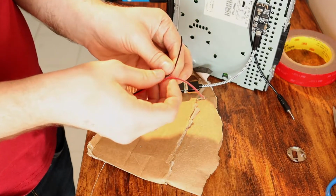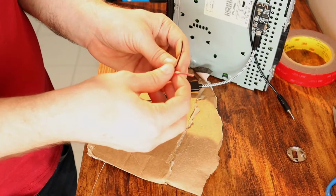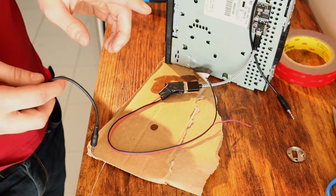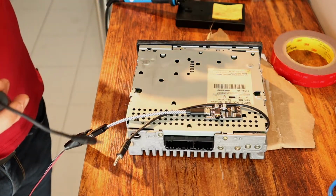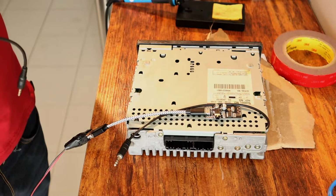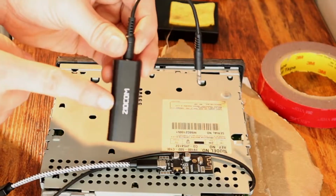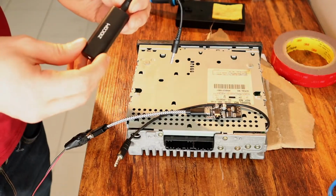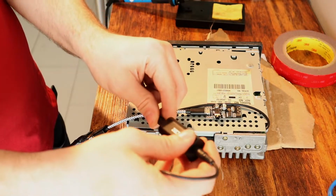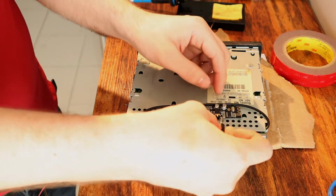And basically I'm gonna cut into the wires that go to the power outlet. But because of the way that we're getting power and the way that we're grounding this, this is gonna cause a ground loop. What'll happen is you'll get a lot of interference noise. You'll actually hear the sound of the disc spinning. You'll hear alternator whine, and it's just not gonna sound very good. So what you do is you buy one of these. This is a ground loop noise isolator. Again, they're very inexpensive, and I'll link them in the description. So we're gonna plug this into our ground loop isolator, and then this goes into our Bluetooth chip.